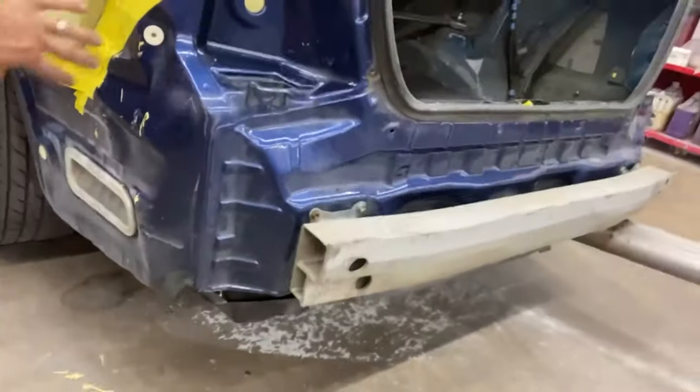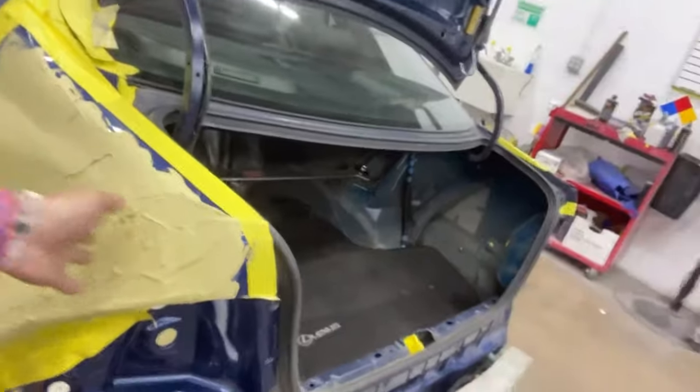Luckily, with Bondo, it's how you take it off, not really how you put it on, as long as you got it mixed right. But as you can see, my tape job was very necessary. So I'm gonna buzz this down, I'm gonna re-apply it until that's not there anymore, because that's a low spot still. So I don't wanna take all this build off around it, cause I need to build this whole thing. So I'm just gonna take the big bit off of the DA, 36 grit. You can use a Bondo Buster, I like a DA, it just keeps me consistent.